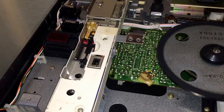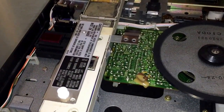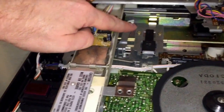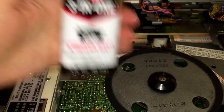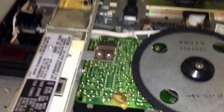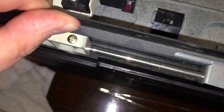For the return-to-normal process, go ahead and remove the stylus, take it out, don't touch anything in here, close the little lid, and push the little button down. I'd also recommend putting a little bit of light machine oil — I use 3-in-1 oil — on the bar in the back: put a little on your finger and rub it across that bar. There's also another bar in the front; put a little oil on that one as well, underneath that plastic piece.